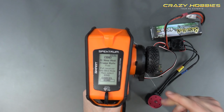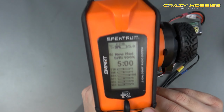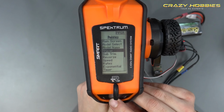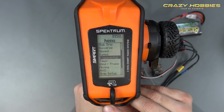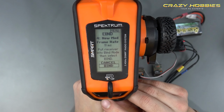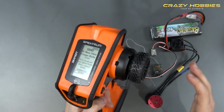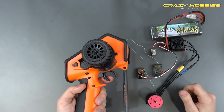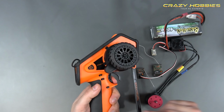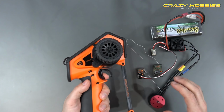With your electrics, on your controller, make sure you see how I've set my brake to 100%. All right. You want to make sure your brakes are at 100%. Okay, so failsafe. When I'm binding, when I hit OK, wherever I have my throttle trigger set, right? So that's brake. You don't want to pull the trigger down and then bind it, because when your controller turns off, it will hit full throttle. So I'm going to show you guys right now.